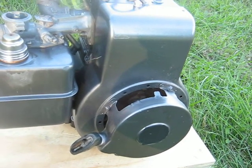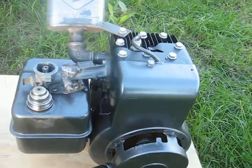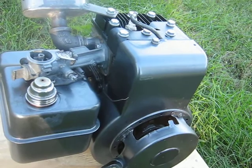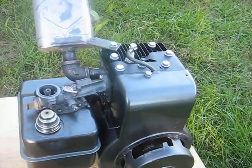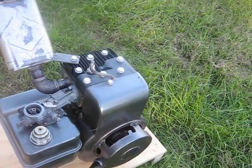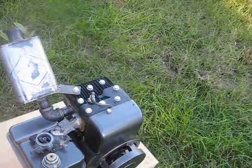I know for a fact I put oil on it when I built this engine a week ago. But a fellow YouTuber was right — that's what the problem was. We'll fire her up here and rev it up and see if I've stopped the squealing. I took his advice and put some transmission fluid on the shaft as opposed to oil. Normally I use oil, but it's transmission fluid, so we'll see how it goes.